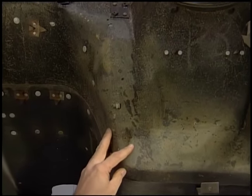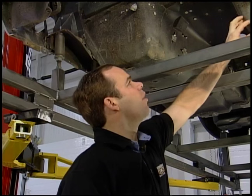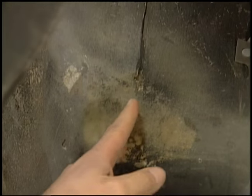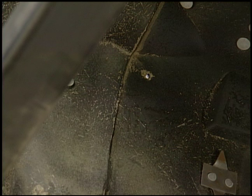We also found a fair bit of damage around the bell housing area and the firewalls. I think what happened is at some point this L88 Corvette was at the drag strip, the guy rips a clutch out of it and tears up the whole firewall. The repair has been made, but we're going to have to fix this here, because you can see where the two pieces of fiberglass were bonded together and you lose that whole seam on the fiberglass repair. We're going to have to make that look original again.